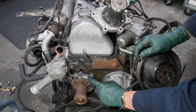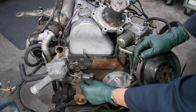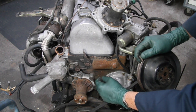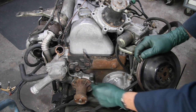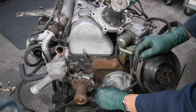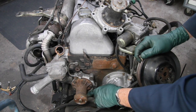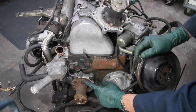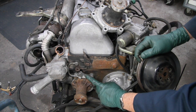Trying to tap and drill into that aluminum is near impossible. So if these bolts aren't coming easy, work them out a little bit. Squirt some penetrant in there like Rust Buster or any other lubricant that will really soak in, then work the bolt back and forth. You've seen my other videos on how to work these bolts out of aluminum. Anytime you're installing a new water pump with the old used bolts, use anti-seize compound on the threads. Always use anti-seize when putting steel bolts into an aluminum housing.